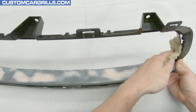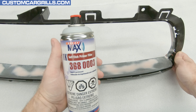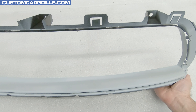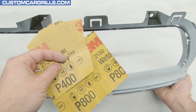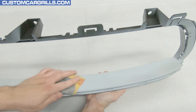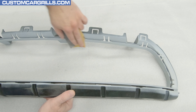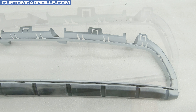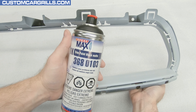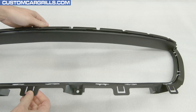I'll get a tack cloth out and thoroughly wipe down all the surfaces so that there's minimal dirt and dust left over from the sanding. Then I'll grab some aerosol primer filler — I like the Spraymax brand and their 1K self-etching primer is usually my go-to. Once primed, I'll get out some sandpaper again: 400 grit to knock down any remaining dust or dirt nibs from priming, then later sand the whole thing with 800 grit to smooth it out even further. To flat black this back to a professional finish, I'm using Spraymax's 1K trim paint in the matte black finish.